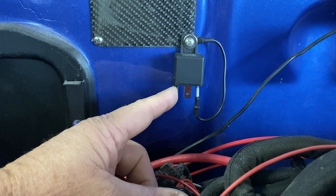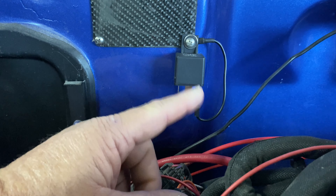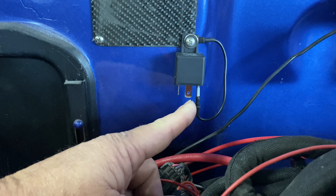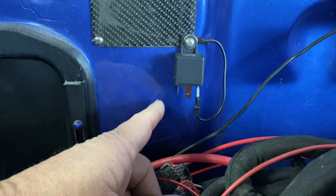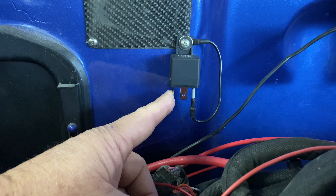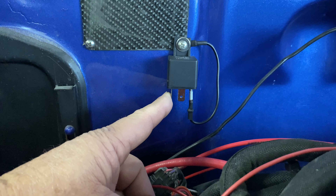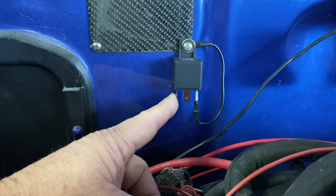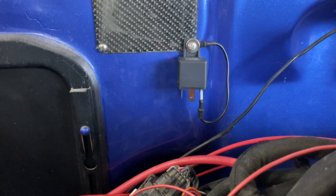As you power the coil - it's a little magnetic coil inside that moves a switch. These relays can be four or five pins and have normally-open or normally-closed configurations, so you can have it on until you switch it off with the coil, or off until you turn it on. This one is off until you power it. The American Auto Wire has a switched power from the ignition switch that normally powers the coil - since we have the MSD, we'll use that wire to power the coil on the relay, which will then power a wire from the battery through the relay to the MSD block.